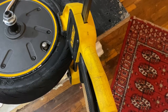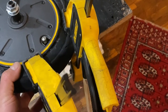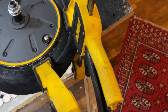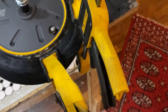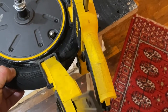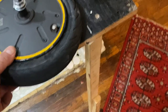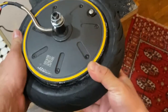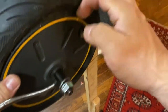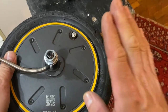In this case we're going to have to use a second clamp because it's not releasing. And that's it — that's how you get it out. We know this tire is done, so even if it gets damaged it's all right. When you guys use slime on it, this thing gets really attached to the edge, and that's why sometimes it's really hard to get out, especially when you let it sit for a long time.